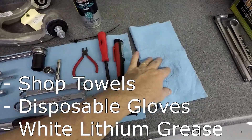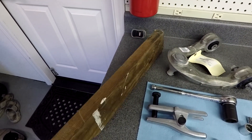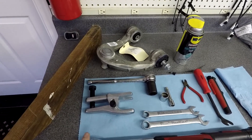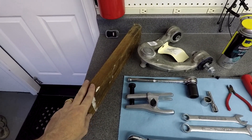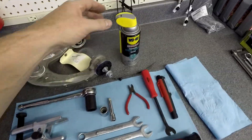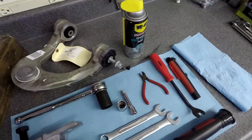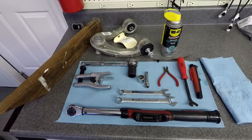An inspection light is always a good tool to have at hand, and some shop rags would also be useful. You're also going to need a piece of wood - a chunk of four by four would work better, but a two by four is okay. Eventually we're going to have to lower the car onto the suspension without the wheel attached because you have to tighten the bolts back up to torque spec with the car in its resting suspension position. You might also want a little bit of white lithium grease to coat the bolt shafts so water won't cause them to rust.